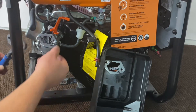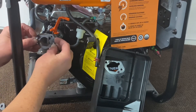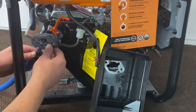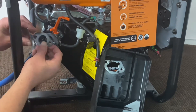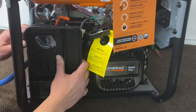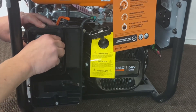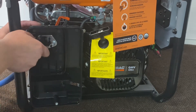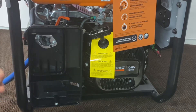Now that we've got our studs pulled out enough to give us clearance to get our air cleaner box back on, we'll go ahead and install the gasket back on. Get our slim adapter put on there, and we'll supply you with two other gaskets here. Go ahead and get them on there and get this back up. You can see you've got plenty of meat left on there to get your nuts back on.